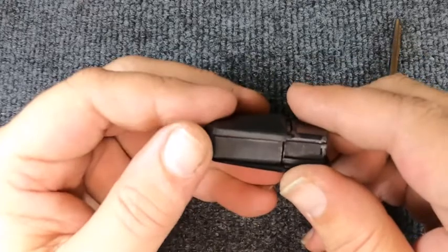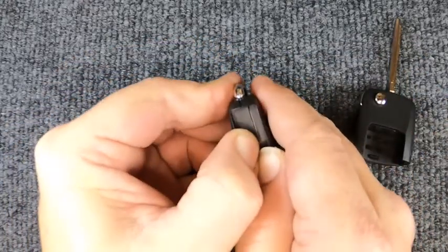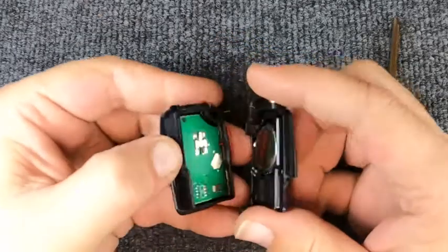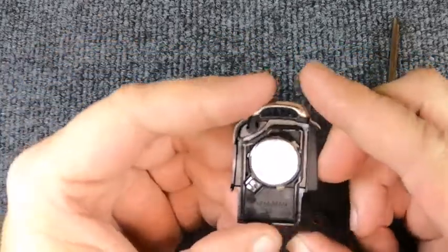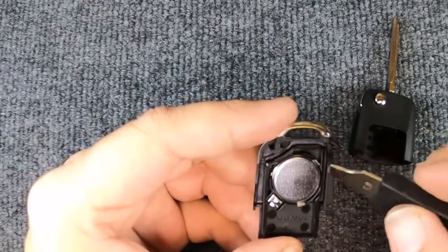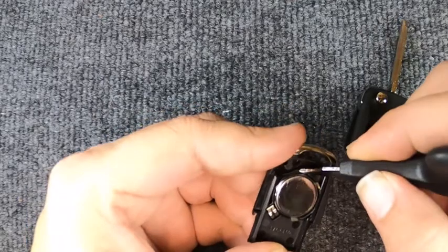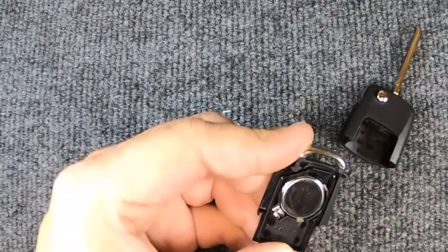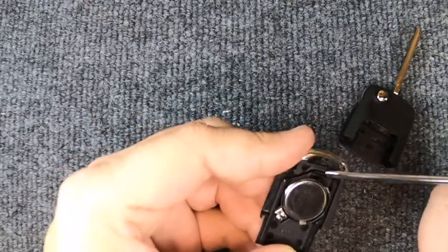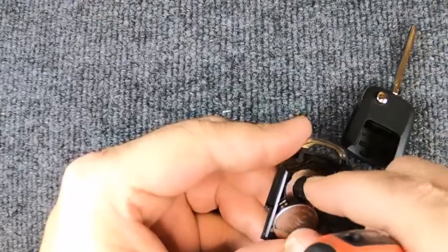There's nothing you're going to use on that side, so come back to this side. Put your thumb in there with the other thumb and pry the two halves apart. You'll notice you've got these little metal tabs — do not pry there. You want to go over to the spot where there's not one. Take a flat tip or whatever you have that can get up under there and just slowly lift it up, and the battery pops out.